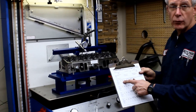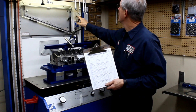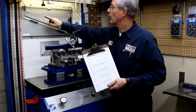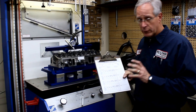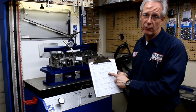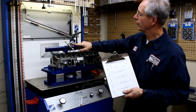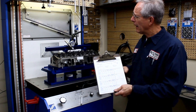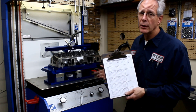Once we get down to 100 and 200 lift, I would rather be flow testing at 70 to 80% of 153 CFM — which is the 100% of that particular range — rather than down around 20 or 30% of the 303 range. Another thing we do when we flow test manually is on the sheet we have 101, 202, 303, all the way up to 707. The reason I do that is because when I'm opening up the valve, I can go to 7, 6, 5, 4, and that will remind me where I am. If I get interrupted, I can always look at that and know that I'm at 500 versus maybe at 400. It'll make it a little bit easier when I do the test.